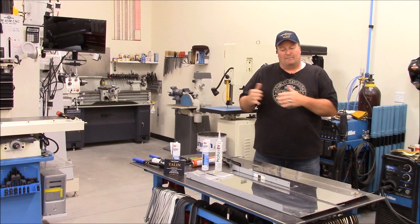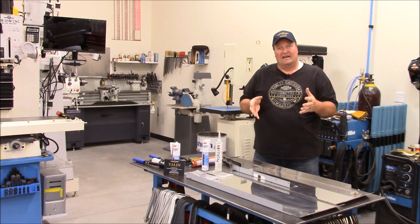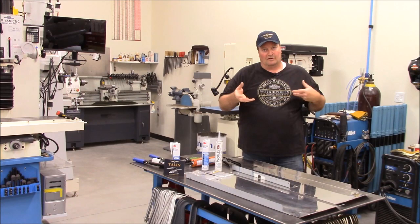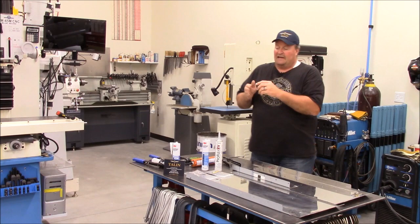That being said, let me back up and give just a little bit of brief history here. I know Chris does a fantastic job covering it in his videos, but I just want to give a brief overview. The Monaco Holiday Rambler design, dating all the way back into the late 90s, early 2000s, did their slides a little differently than the industry standard. The industry standard was basically you had a floor and a sidewall of the slide, and it was encapsulated on a corner by a trim piece or a bracket, if you will. Monaco did theirs a little differently, where on their floor they put a piece of extruded aluminum that turns up only about a half an inch, and then the sidewall resides in behind that.